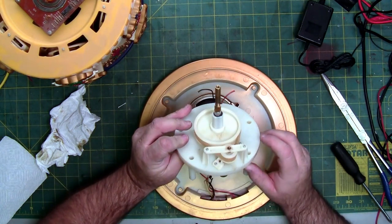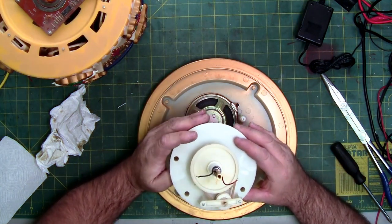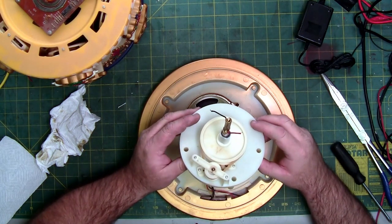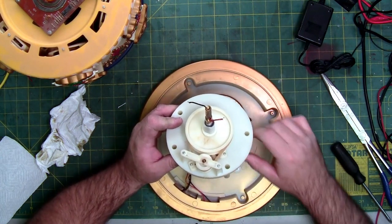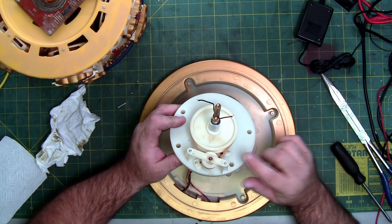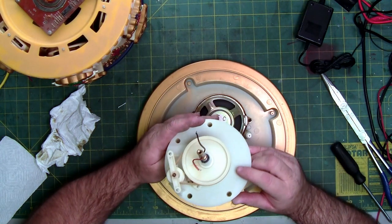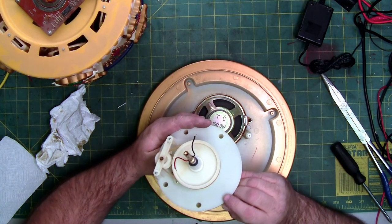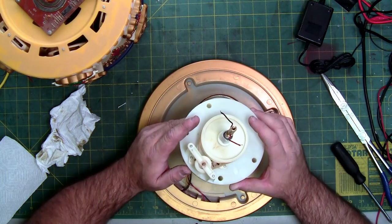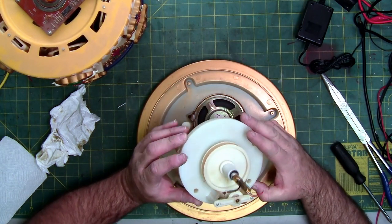Before we check those out, let's also check out the gears. The gears are right up here. This reinforcement bar that keeps these parallel to keep the tension of the pulley is also split. These teeth are really, really worn. A normal gear looks cylindrical from its profile; this drive gear is concaved — it's been worn in really well. It might be slipping. We have two standard flat gears and two worm gears. Everything else as far as brackets and reinforcements looks good; it's just the one on top that's cracked.